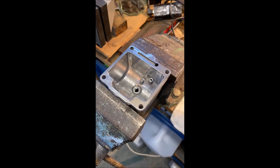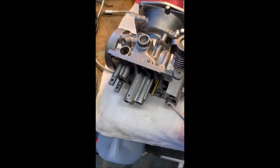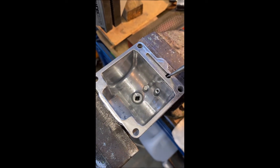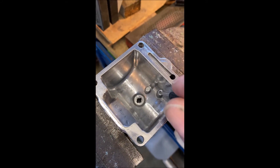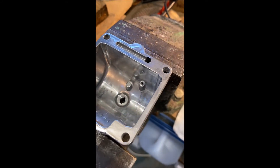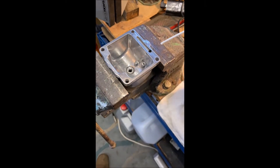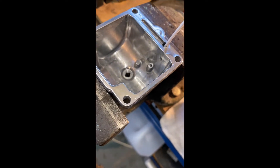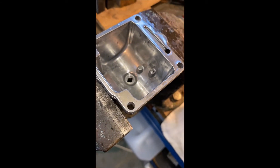To make the carb circuit complete, this brass tube goes into the carb bowl here and it picks up fuel, sucking it up through this hole here. If that's not clear, it isn't going to work. So get your carb cleaner down this hole and make sure it squirts out at the bottom. Perfect.